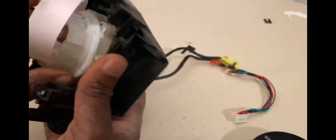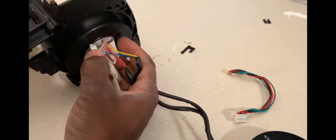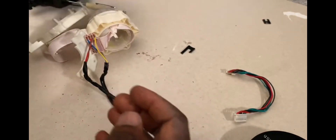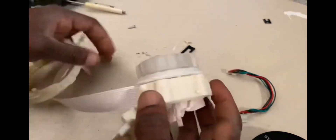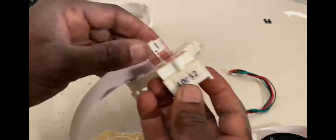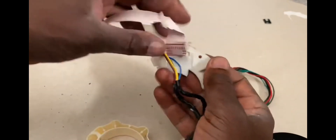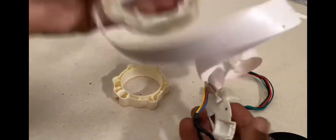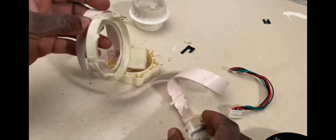Now here is what they mean when they say the horn doesn't work. This case here is just a case that holds it — like a video tape. When the steering column goes left, it pulls this wire in; when the steering column goes right, it pulls it the other way. In order for us to be able to turn the steering column from left to right and right to left, we have to have this cable inside here. The electrical connector from the car comes in here, and through this you also have the horn wire — ground, power — and then cruise control, wherever the car has it.